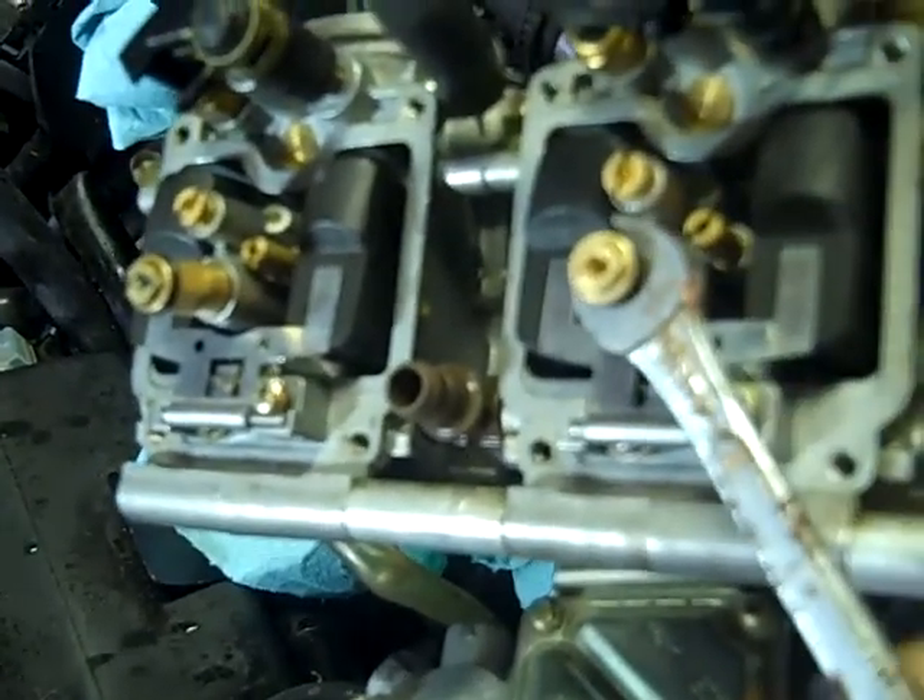When you're putting the jet back in the carburetor, right here is the needle valve - that's for the throttle - it's right here in the center. I didn't take the top off so it's still in there. I can reach inside and push it down - I just push down on the slide, make sure that you put it so that it goes inside the jet. Slide the jet in there and then turn it in all the way so that it seats against that rubber washer. The 8mm wrench fits on it - you just tighten it snug, just so that it doesn't leak, just barely tight - not real tight.